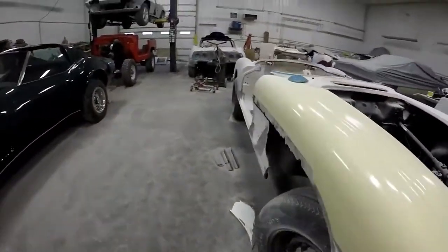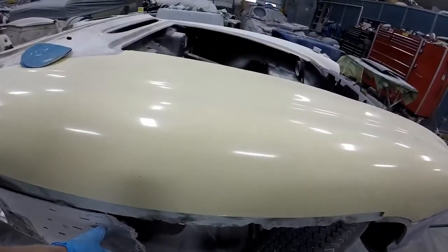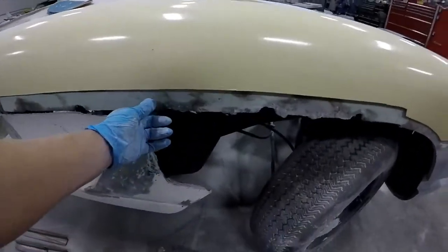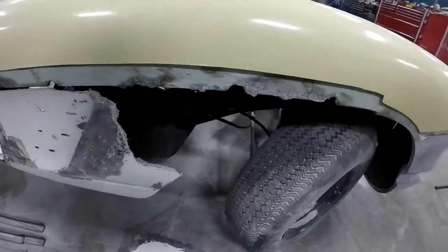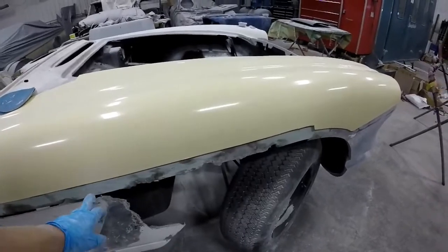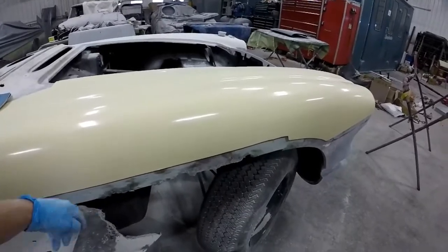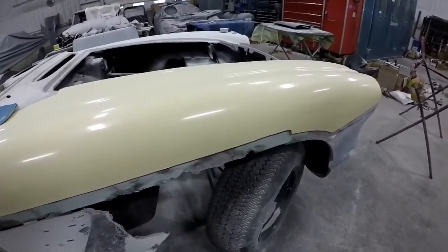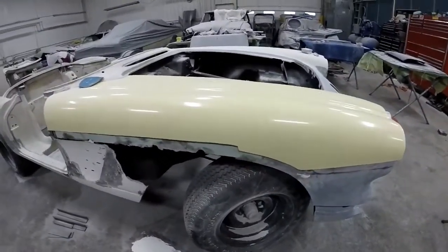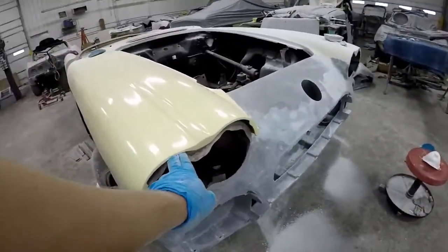And this side, like I said before, this car was on fire at one point, so they used a hand-laid panel over here that was overlaid on top of this bonding strip, which they only attached with like Duraglass, and they cut the fender underneath here way too high. I don't know if they forgot to account for the height of the bonding strip, because it should have fallen here, so they used a bunch of glass, and it's a shame because this was a brand new fender cap under here. It was never really used. It was primed but never painted.